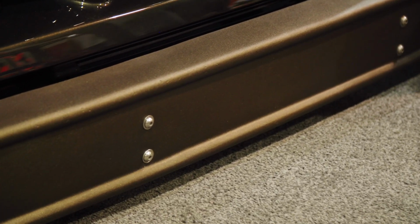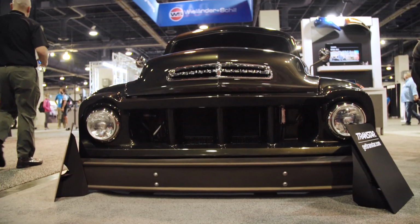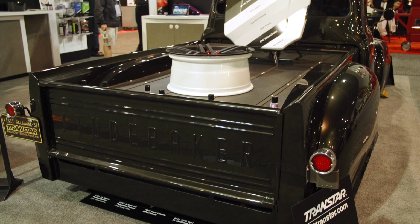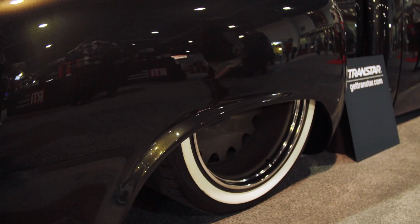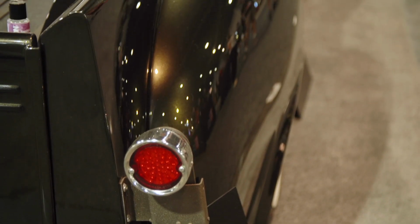As far as body modifications, they were kept pretty simple. The front, there's really not hardly any at all, that's just how the Studebaker made them. But the bed, we extended the bed down so that when it was laid out, the whole body, the rocker, everything looks and matches. The rear fenders, we had to extend 5 inches so that when it laid out on the 20-inch wheels from Detroit Steel, they could clear those.